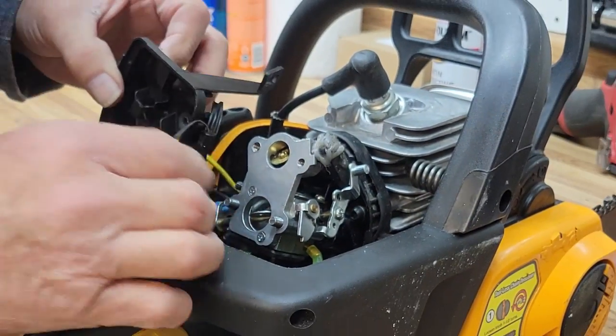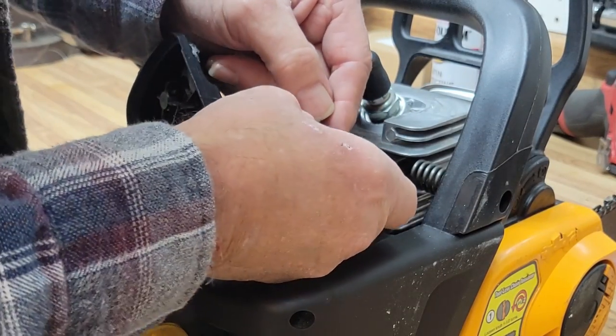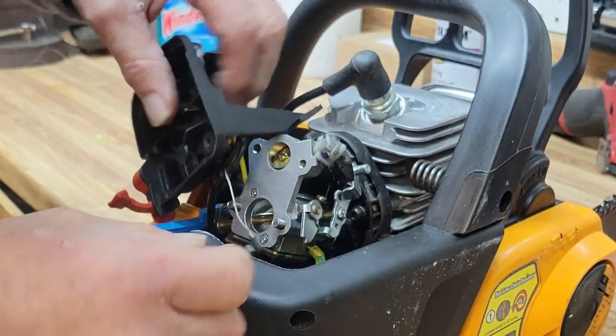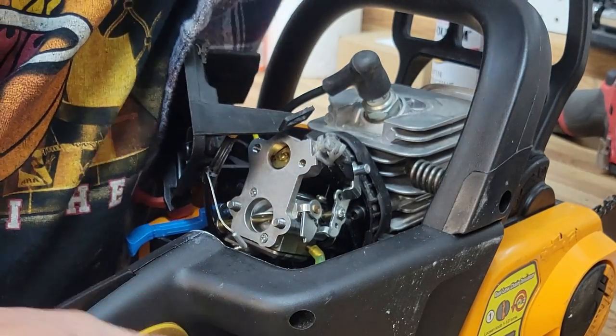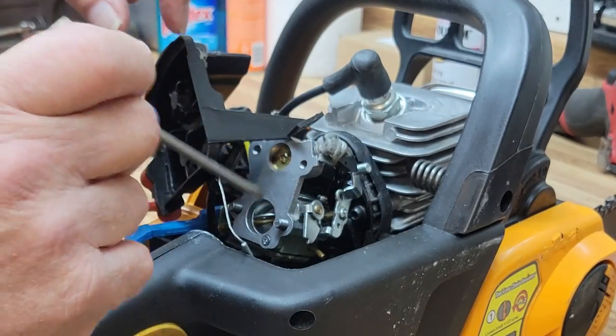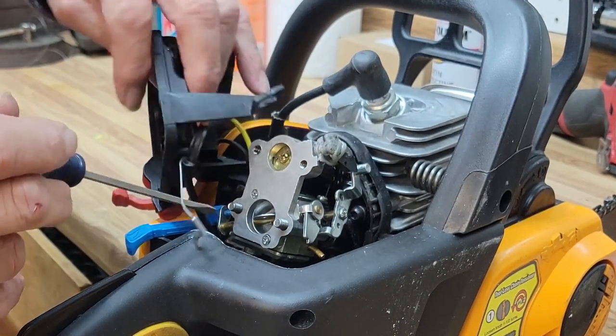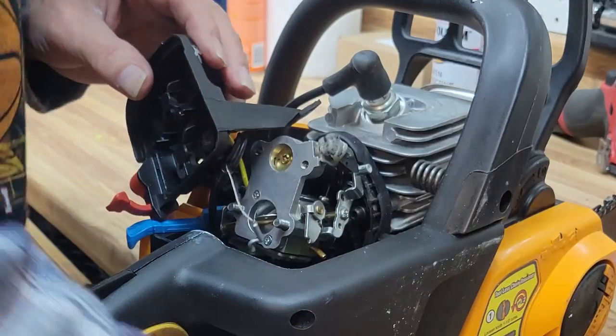And, oh, good Lord. Looks like somebody's played with this carburetor more than a little bit. I don't know quite what that is, but I do know it didn't come stock that way. Let's go ahead and pull the fuel lines. And remember, before you pull the fuel line off, make sure you loosen the gas cap, or fuel will go backwards up the line to you.